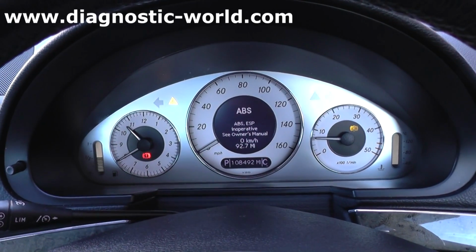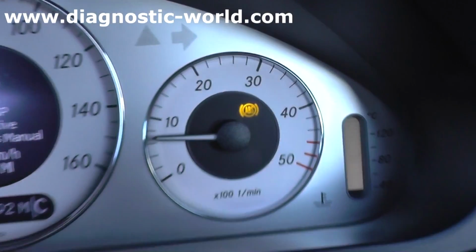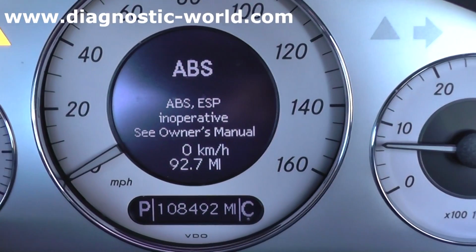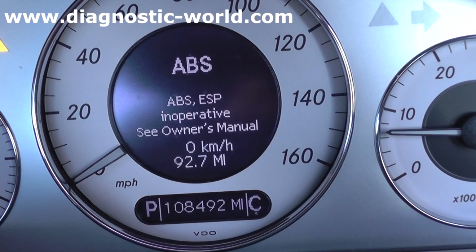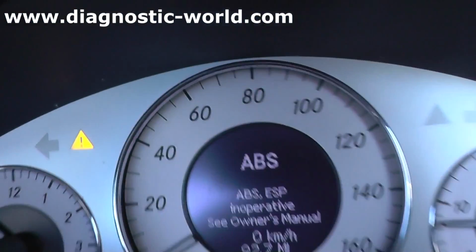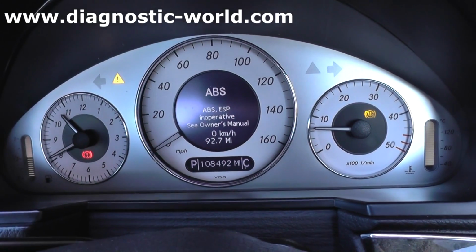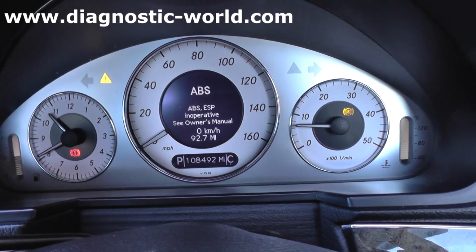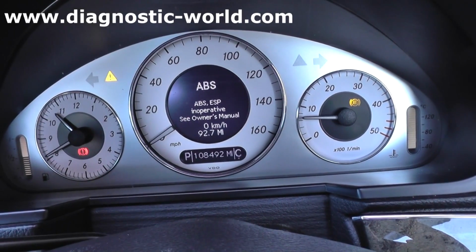Now this is the telltale sign that you do have a faulty ABS sensor. We'll zoom in here, you can see we've got the ABS warning light showing on this dial. In the middle we've got "ABS ESP inoperative, see owner's manual", and we've got the ESP warning light showing as well. So that tells us that there is a fault within the ABS system. The next thing you'd need to do is hook it up to a diagnostic tool to actually find out where exactly the problem is.